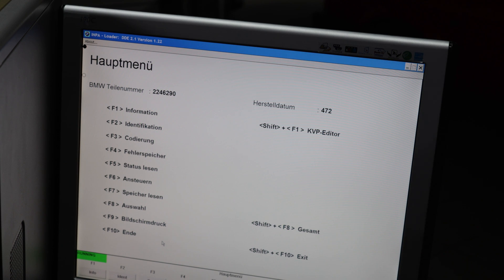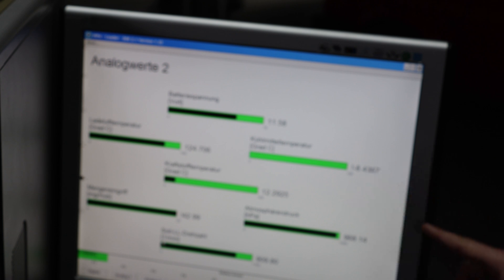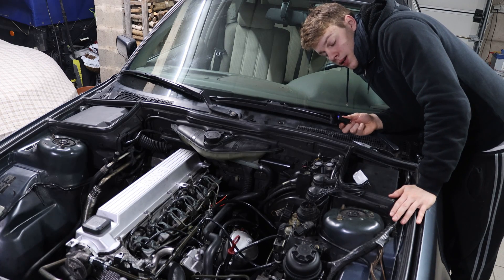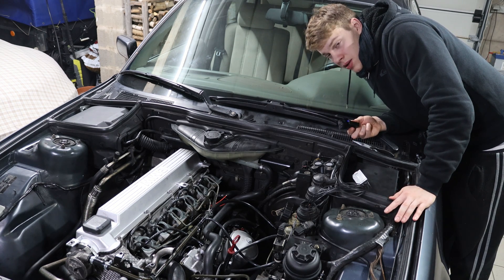Now that we've cleaned the contact and the sensor, let's see if the error still persists. It still says minus 8 — still wrong. No bueno. I think I'm going to have to cut off the connector and check how far the water went into the wiring loom and then replace it from there. I'm going to cut off the connector and test with two individual pins to see if it works. If not, more diagnosis needed. I also need to go and read what the exact error codes are — there is a short in some part of the coolant temp sensor circuit.